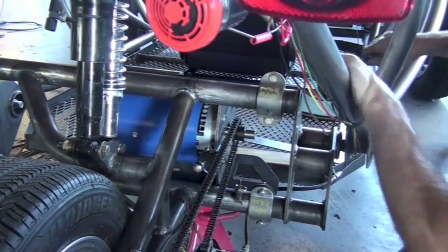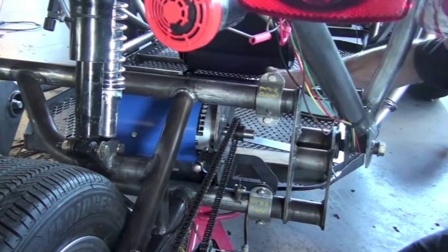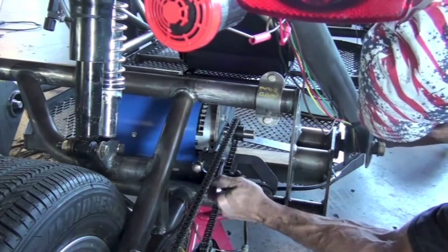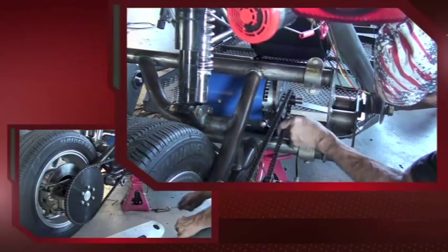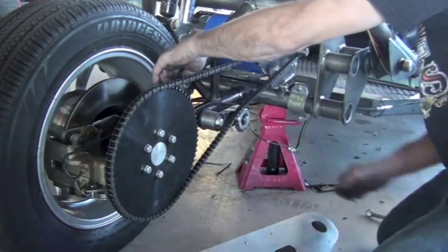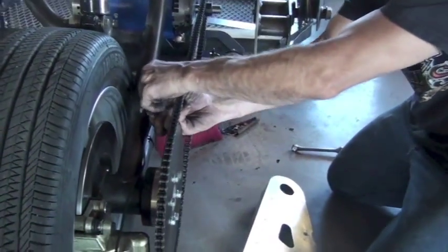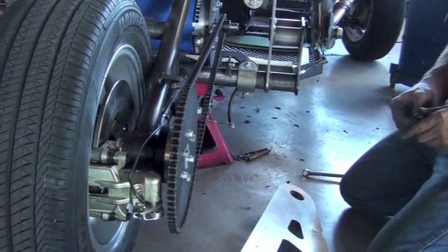With everything aligned and distanced properly, we want to tighten up the bolt pattern on the motor to the subassembly. We're going to tighten the motor to the subassembly by alternating the bolts — tighten each one alternately around until you get them all tight. After the chain is on, we can put the chain guard in place. There are two mounting bolts for the chain guard. One is backed by the rear wheel sprocket on top and goes down from the top down into the chain guard.